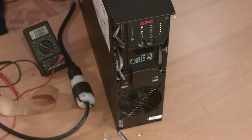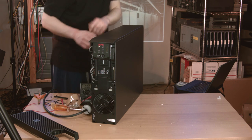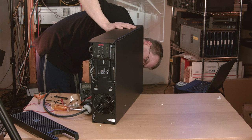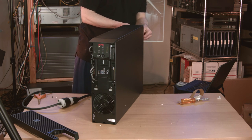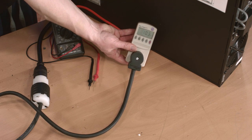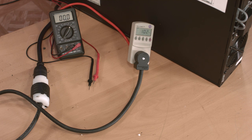The only troubling thing about it is a slight buzzing — I first thought it was caused by the fan, but it turns out to be some component in the back. Hopefully it's not a bad transformer or something like that, but it's an investigation for another day. Output from the back of the UPS, now with the meter properly set to AC mode, shows a hair over 120 volts, which is just about perfect. Now I'll plug my trusty kilowatt meter in line with it and check a few more stats. It's reading about 100 watts with no load on the UPS — that's due to a combination of the battery charging, running the fan and onboard electronics, plus a little loss to the inverter circuit.